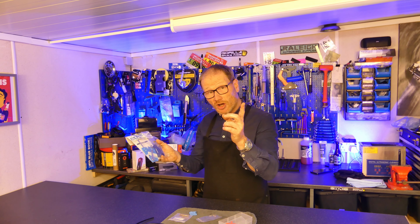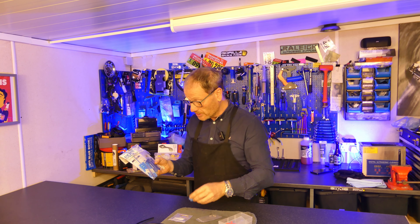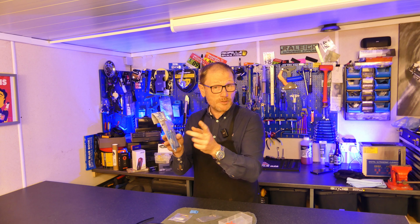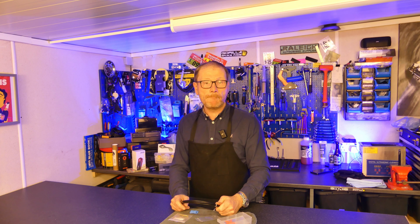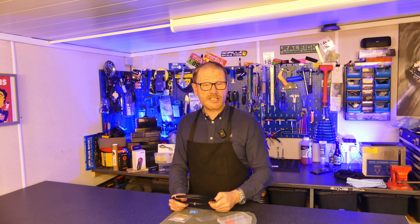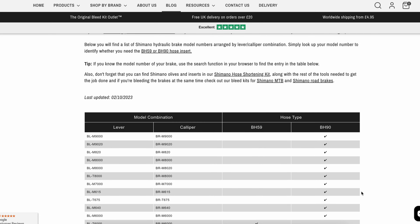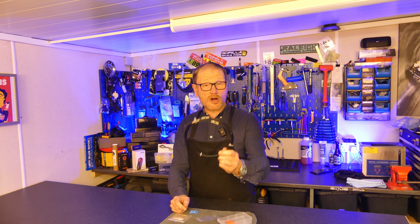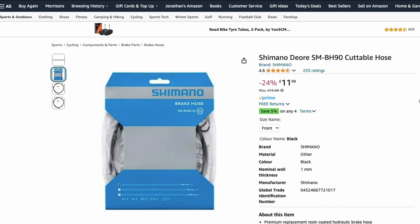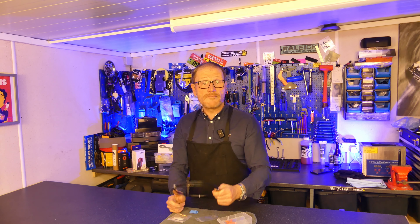This kit includes the specialist hose cutter tool, the basic clamp that clamps the hose when you put the barbs in, and it comes with both barbs and both olives that you need — they even include a couple of spanners. Shimano hose comes in two sizes: BH-59 and BH-90. We're working on modern Shimano road today so we'll be using BH-90. Epic Bleed Solutions have a handy chart on their website showing what size you need for your specific groupset. You can buy non-Shimano cheap hose online — don't bother, because it expands under pressure and gives you spongy brakes. Buy the genuine stuff, available from your local bike shop at roughly £10 a metre, or online in various lengths.